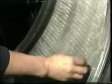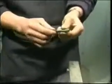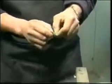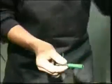and shaped round to fit the size of a stem. Fill the hole with enough Super Vulcan G, Moderni's vulcanizing adhesive. Attach a pulling wire to a stem that fits the size of the hole. Apply Super Vulcan G to the part of the stem that stays in the tire.